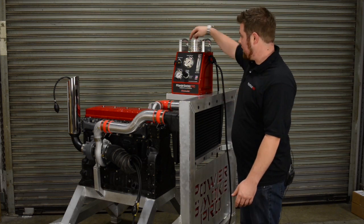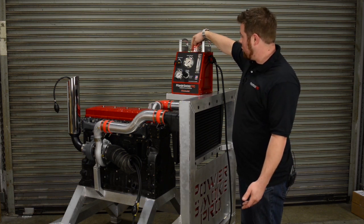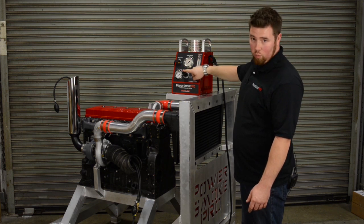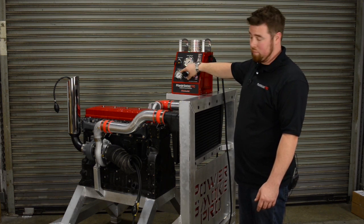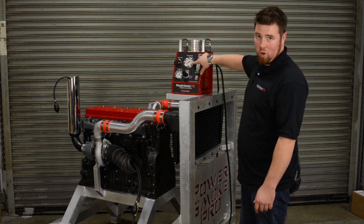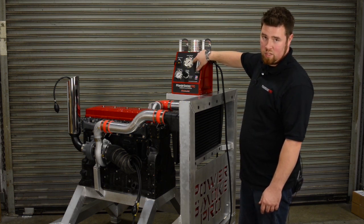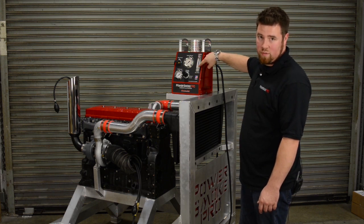The equipment is very simple to use. It has a simple on/off button to induce smoke or to do an air-only test. Push the button to turn on a 10-minute smoke cycle. There's a regulated pressure adjustment so you can see how much pressure you're putting into the system, and an adjustment knob to set the pressure accordingly. We also have a system pressure gauge to tell if the system is holding pressure or if there's a substantial leak, plus a flow meter to help determine the size of the leak.